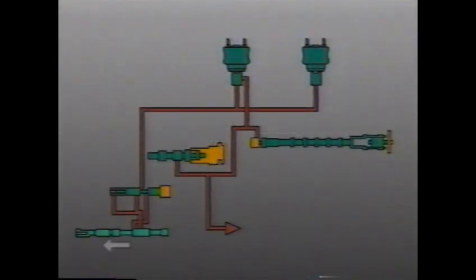The fourth clutch circuit is very similar to the third clutch circuit. When the driver selects the D4 range, the manual valve allows line circuit oil to flow to the actuator feed mode valve, which again sends it to both the third and fourth clutch actuators. To shift into fourth gear, the TCM opens the fourth clutch actuator only, which sends oil throughout the fourth clutch circuit. So the difference between the third and fourth clutch circuits lies in which actuator is operated.